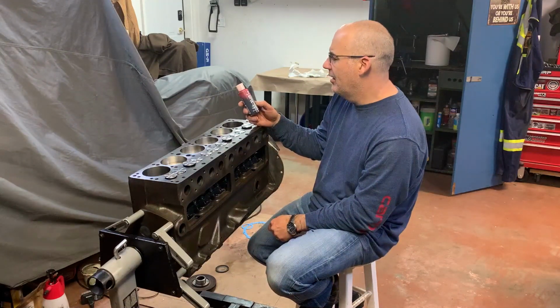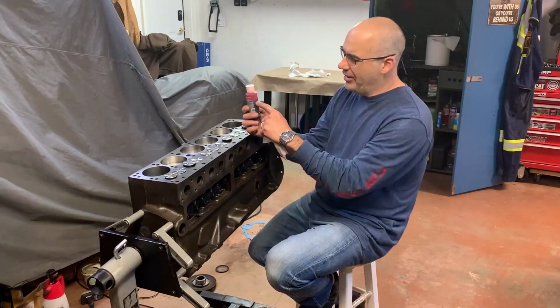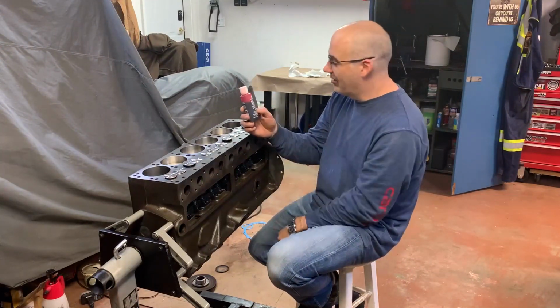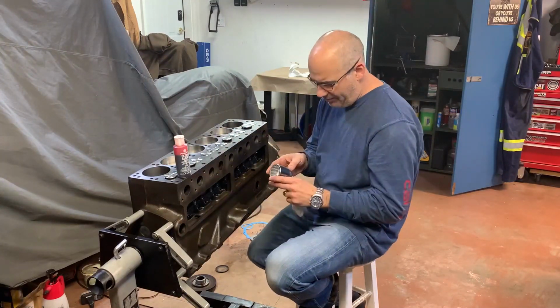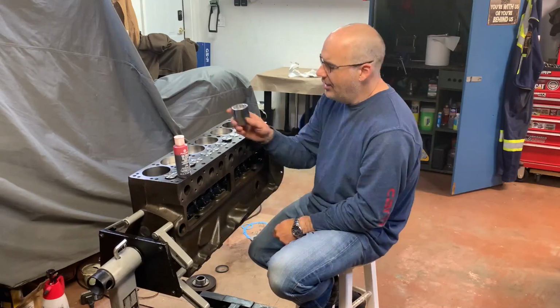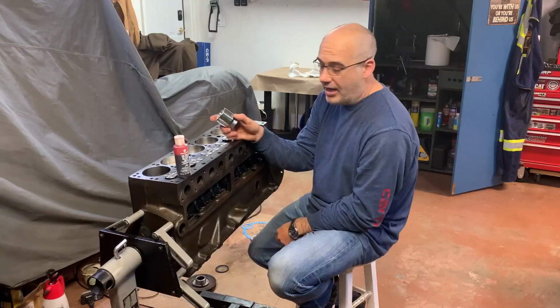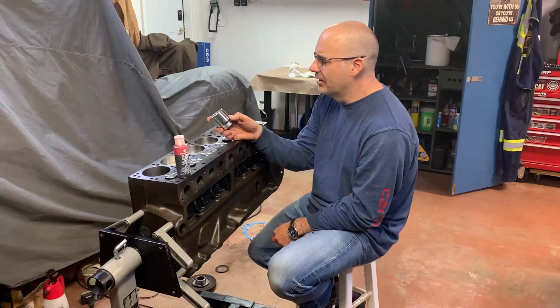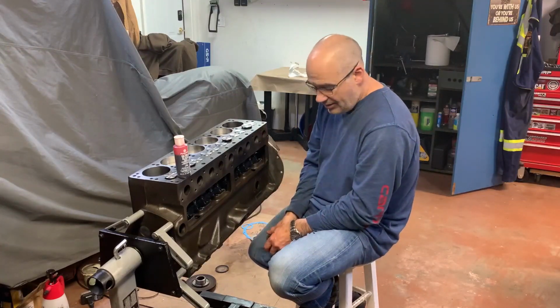The Slick Lube, Ultra Slick Engine Lube, Permatex. Didn't use much, maybe just over a quarter of a bottle. Goes a long ways. Someone's going to ask me, I know they are, what size is the nut on the end of the crank? I used 1 3/4. It's a little bit big. It's the closest I had. It worked. It's probably good enough. You could go down a size from there, I think.